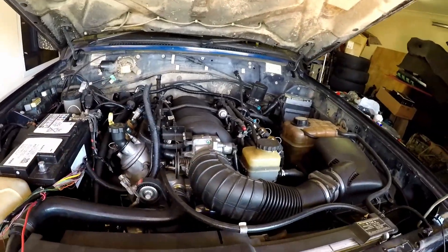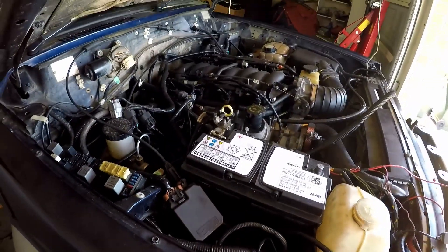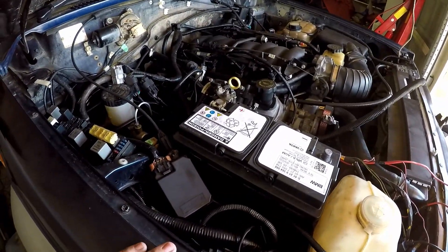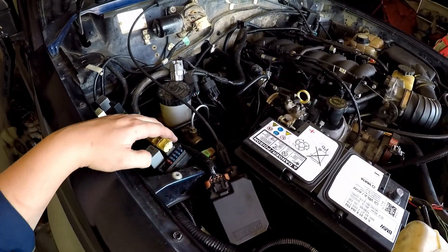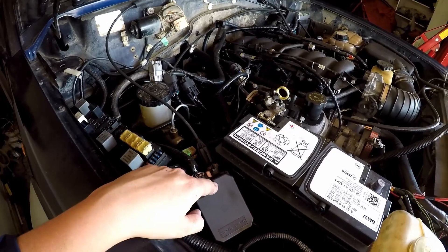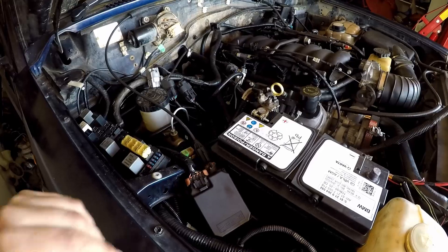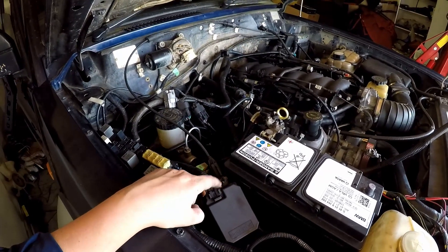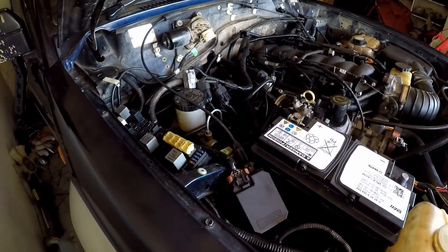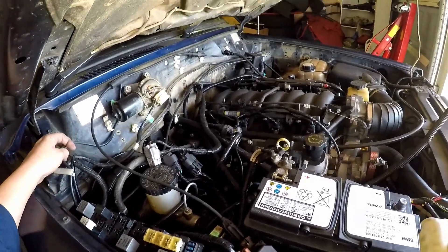Put the battery in here. Over here we still just have everything kind of placed in for now. So that's the actual cruise control, which hopefully I can get to work. I think the only issue with that is the brake sensor — to tell you if you're braking, because if you brake it turns off the cruise control. Currently it's an open circuit, so it will never turn this on because it thinks you're braking at all times. So I'm going to have to find which wires they are, which I already cut out of the harness.